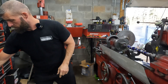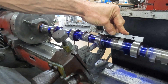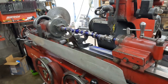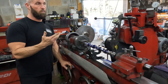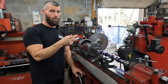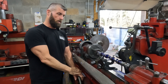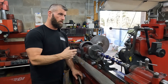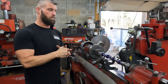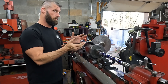Now one thing I want to point out again is luckily those lobes were small. If those lobes had been the correct size for that journal, we could have done that, but you wouldn't have been able to put it in the block because the lobe would have been taller than the journal, and then we'd have to regrind all the lobes too. Some of that stuff — the labor involved doesn't make it worth it. But I think this was a reasonable cost to be able to salvage a billet custom core to go back in a standard block.